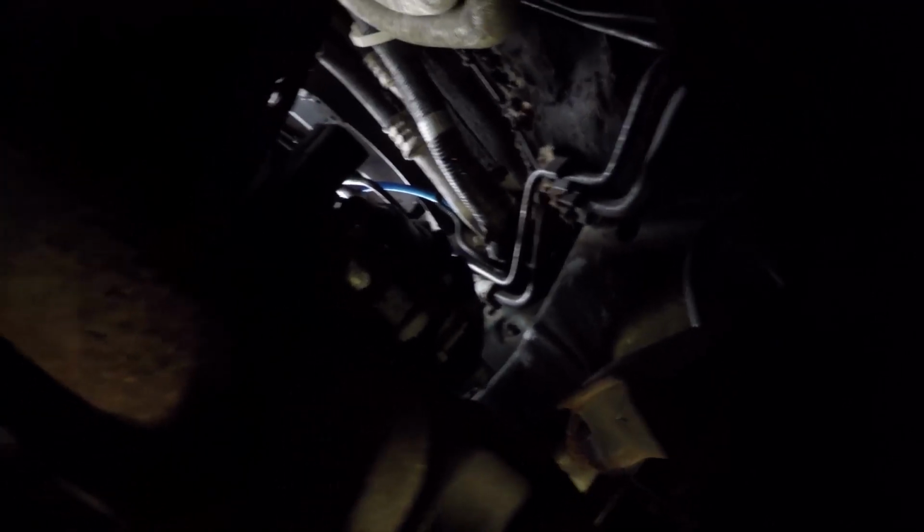Alrighty, around the bottom now, you can see the alternator. I'll point to it right there. On the, I guess, closest to the passenger side, there is a nut on the lower stud, we'll call it. We have to take that off to get the plastic heat shielding off. And then there's also another one at the bottom here on the left, but it's just holding on the alternator, nothing else. And then slightly above, right where I'm pointing, is the main power lead from the alternator to the battery that we'll also have to remove. I'll update you with the size when I get there.